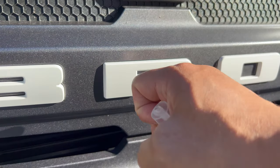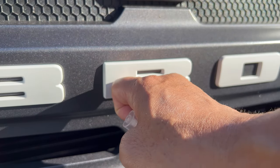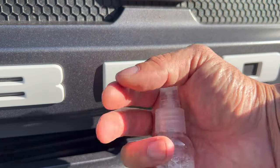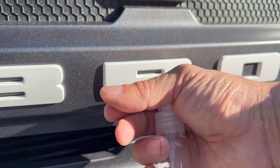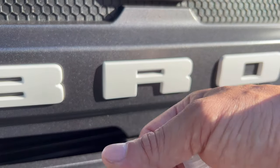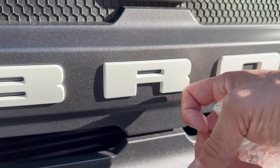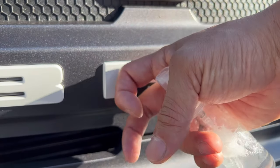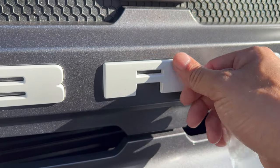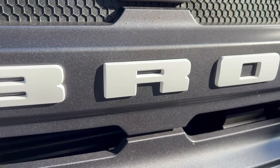It works really well. It allows me not to commit to the initial placement — if I'm off a little I can just move it around, then wait for it to dry or use a hairdryer on really light heat, heat that won't burn your fingers. That's kind of what I use to judge it: if it doesn't hurt me, it probably won't hurt the vinyl. I let that dry out or put the vehicle in the sun, wait for it to get warm, and then push any corners down around the edges, making sure it adheres really well.